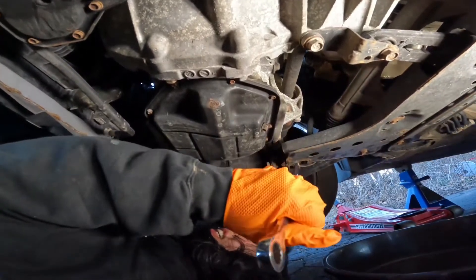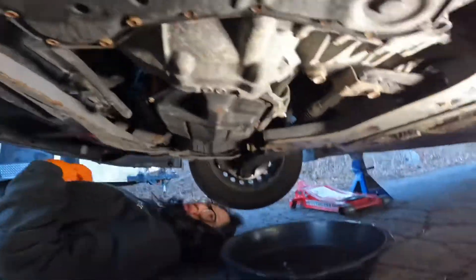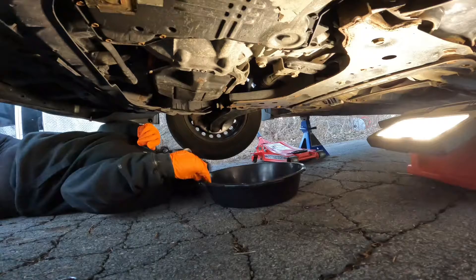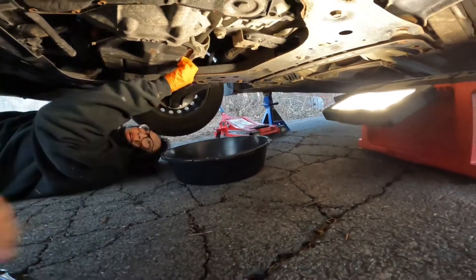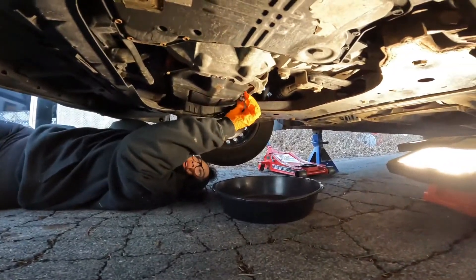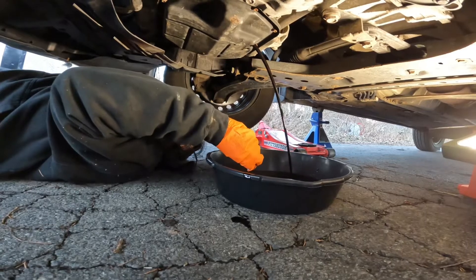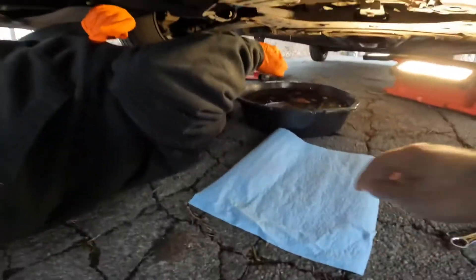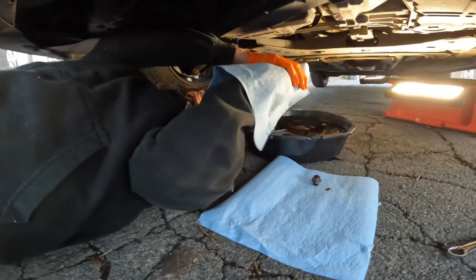That's all you want — spin it. Now you want to move away from the oil plug and set up your bucket because this is going to shoot out. You want to unscrew it by hand, and then once you get to the end you're going to pull it out really quick and let it drain in there. Remember, always have eye protection — she wears glasses, so that is good enough. Then you want to pull your hand over the oil bucket so the oil drains out of your hand. Always have paper towels prepared — usually at least two: one to put the oil plug on top of, and one to wipe your hands, so you don't make any more of a mess.